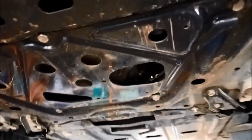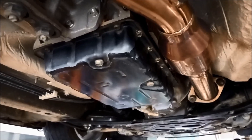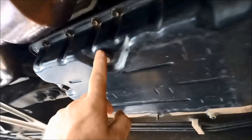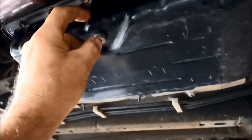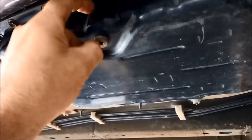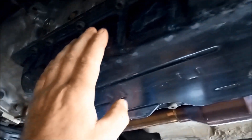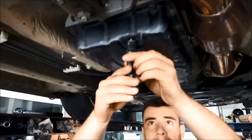All looks good — no oil leaks, looks pretty tidy. These have the A760 series transmissions in them, six-speed. Now if you have a look, I've got what looks like two drain plugs. This one here has a little tube in there — that's where you measure the fluid level — and this one we can drain the oil out on. You can also fill them up here with this plug out, and when that transmission fluid is at a specific temperature, you fill it up until you see it overflowing over that little tube. The motor has to be running.